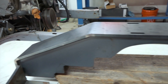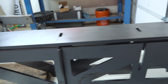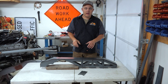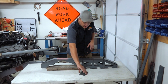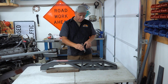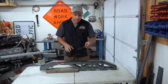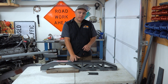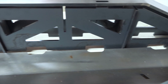I'll take it out of the box and set it up so you guys can see it. They cut everything out really well — it just slots together and jigs right together like a puzzle piece, which is really nice. As you can see, I've got it set up — it all just jigs and slots right together so you can mock it all up. They use little tabs that go right into slots to help hold it all together. It's designed with eight inches of separation, so you'll have eight inches from where your top link would be to the center of your front axle, giving you a lot of freedom in how you set things up.